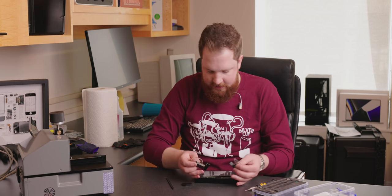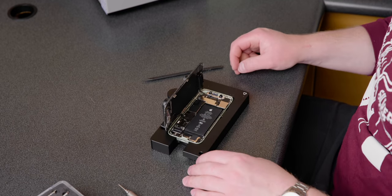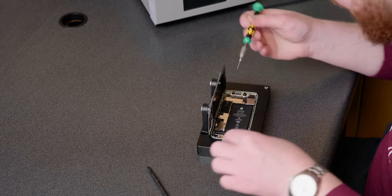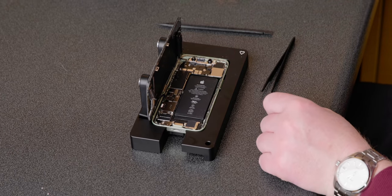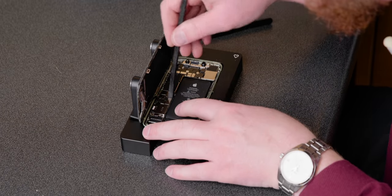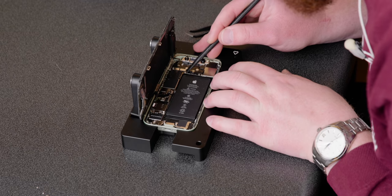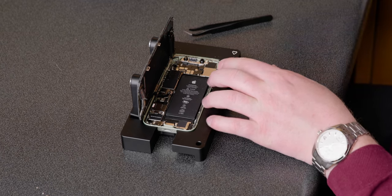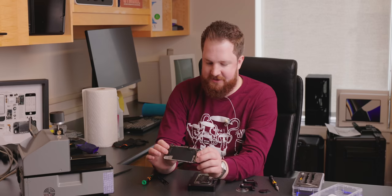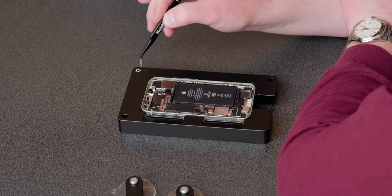I take my two suction cups and place them in this pocket — apparently the solution is just pick it up and stick it. Now I need to remove the EMI covers. This screw is a MicroStix, also known as a tri-wing screw. Our battery is now disconnected. We use the black stick to lift the end of the display flex cable and the receiver flex cable. It's kind of nice that they tell you what each one does. There's our old display — you can see it is just chowdered, bent out the wazoo with no structural rigidity. Do not touch the TrueDepth camera, the grounding pins, or any nearby parts — this is a very sensitive area.